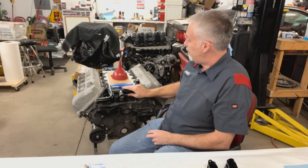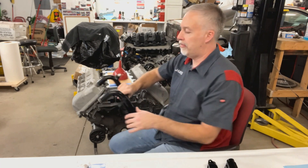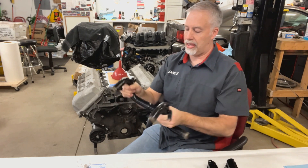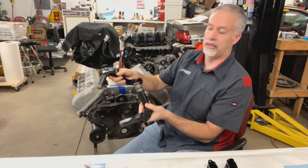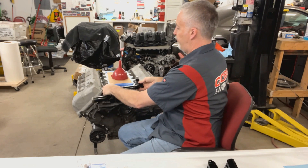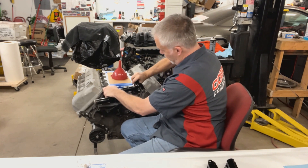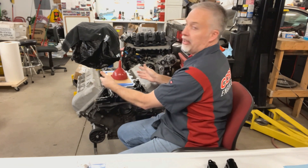To start off, I'd like to talk about the cooling crossover pipe. Everybody's familiar with this ugly piece of metal that Ford did. A lot of people don't realize that they're split — there are two O-rings, and that's the design so they had room for tolerance differences between the heads, and they could fit it on any engine no matter when it was manufactured.